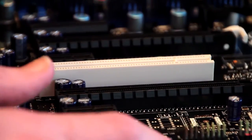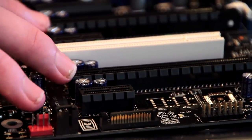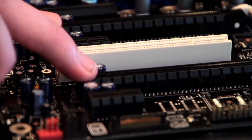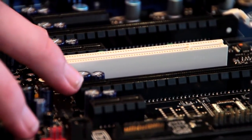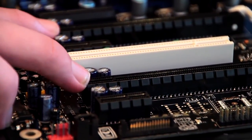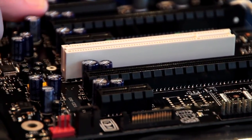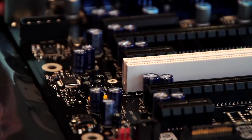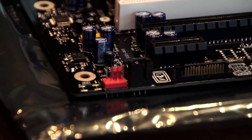And then after that, you have fan connectors, let's see, you have two for the PCI Express, the PCI slots. You have two PCI Express X16 slots right here for Crossfire or SLI, two graphics cards. Before they didn't support SLI, but now they do with the BIOS update. Two PCI Express X1 slots, a PCI Express X4 slot, and just a standard PCI. And then you have also a Molex connector right here if you need extra power for graphics cards. Same thing, a SATA power connector right there.